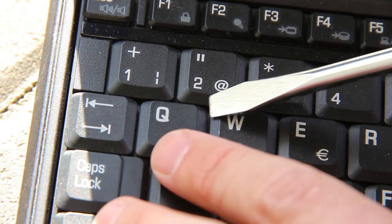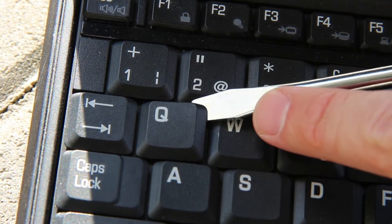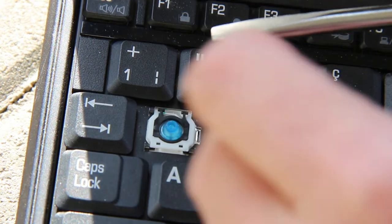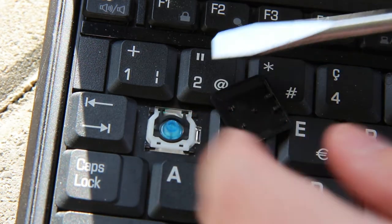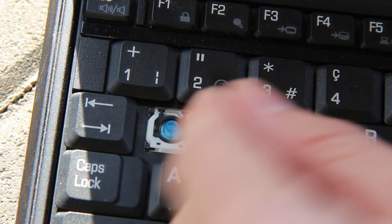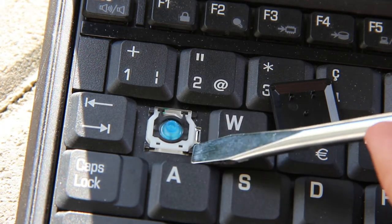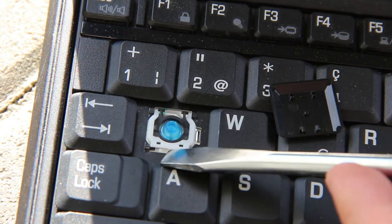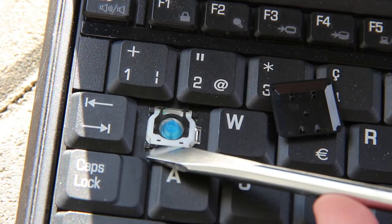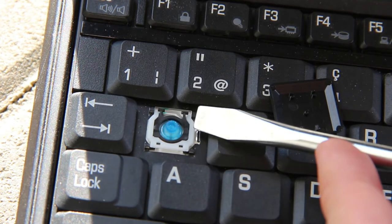This computer is actually going to be recycled, so I don't care about it. What works best is to stick a screwdriver under the key and just slowly torque it. That one popped right off really easily. If it's stuck, try coming at it from a different angle — usually it comes off real easy. You can see it's essentially the same mechanism, just different color plastic, with three hinges: one, two, and then the hinge holding the two together.